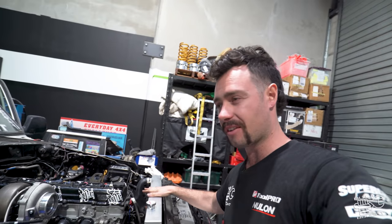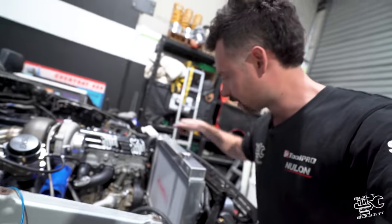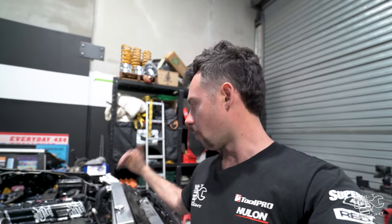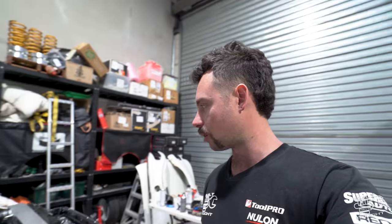So a lot is going through my head at the moment because there's so many little bits and pieces and odds and ends that I'm figuring out as I go. I was about to finish off the last couple of lines to the turbo for the coolant and fill her up, but then I discovered I haven't even sorted out my fans yet. Now I can either go a shroud or thermos — I'm leaning towards the thermos again this time because you can turn them off when you go through a water crossing. Those clutch fans, sometimes if they grab a fin in the water they can punch straight through your radiator. So I need to get this thing out and get a shroud made before I fill it up with water, because then it's a pain in the butt — you've got to flush all the coolant out, drain it and start again. So I think it's time to write a list.